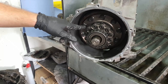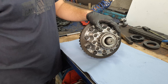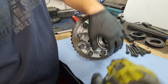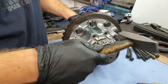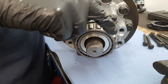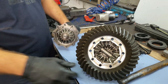That's the unit inside — this is the limited slip diff unit that we need to disassemble. We are now opening the LSD unit to determine the condition of the clutch plates. We need a little help from a hammer to get the cap open. When you do this, please watch out for the bearing — if you're not changing it, be careful not to damage those surfaces. That's the inside of the unit.